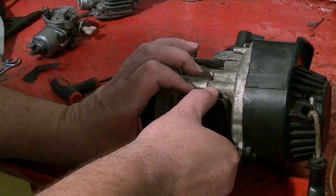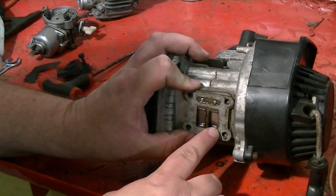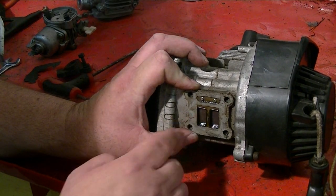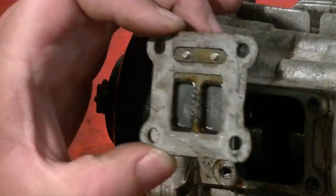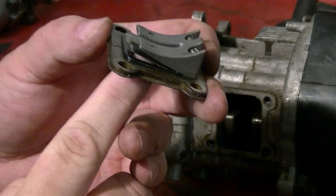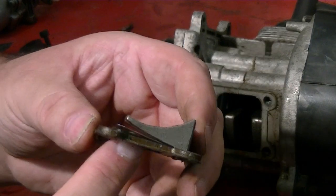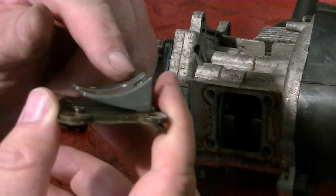Actually the reed bit fell out — I'll show you that. So that's the manifold. This is the back of the reed valve — this is the carrier. These silver bits here, let me get in a bit closer. This is the cage, and if you turn it over, these bits sticking up are the reeds, or petals — depending on what you call them. All kinds of names for this, but here they're just called reeds.